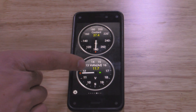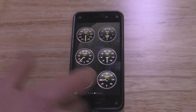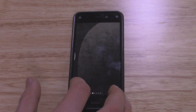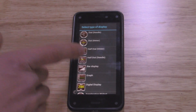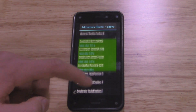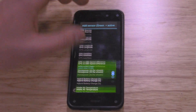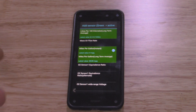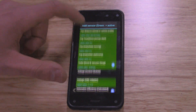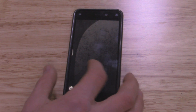As you can see, battery is at 11.7 volts, coolant is at 37.4, and all other stuff. This app is fully customizable — you can put gauges wherever you want, and they have a wide variety of different dials. You can also choose whatever sensors you want to read from your vehicle. On the Jeep Cherokee here, whatever is highlighted in green is the information we're getting from the ECU back on the phone. Obviously on newer cars they'll have more sensors available to read.